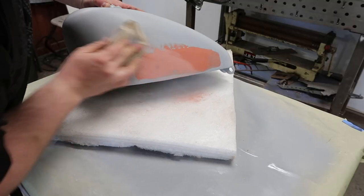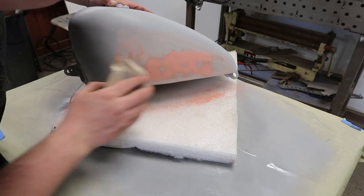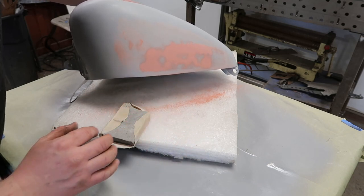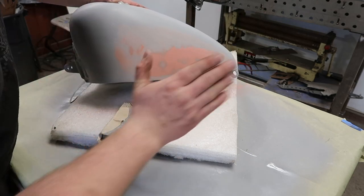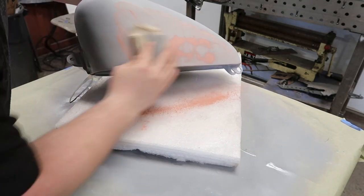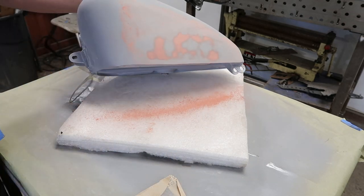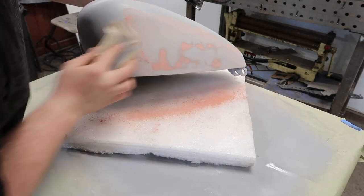You can see those high spots starting to show through — there and there — that was that slight little ripple I could feel. This stuff is great but you don't want to apply it any more than about 30 thousandths thick; get some Bondo or fiber hair for doing thicker stuff. This stuff is great for pinholes and super fine guide coat filler areas. Alternate your pattern, go across the tank at different angles — you don't really want to go fore and aft. Wow, it did have some low spots there — that's exactly why we do this, to check where those little low spots are.